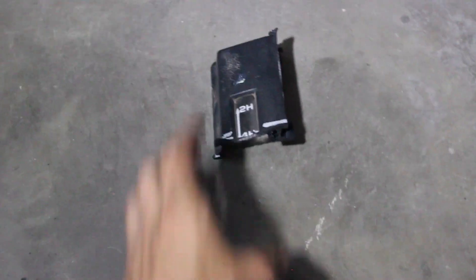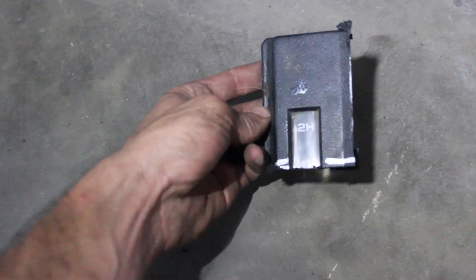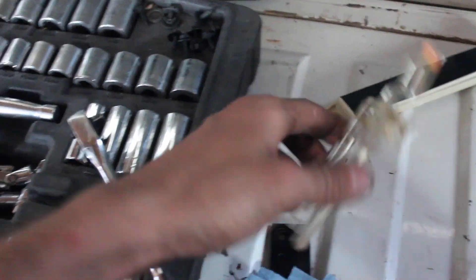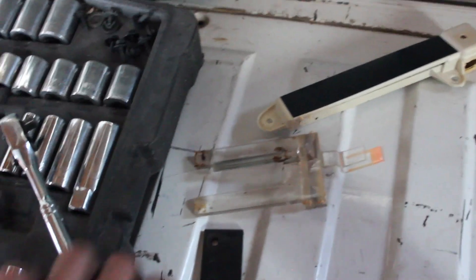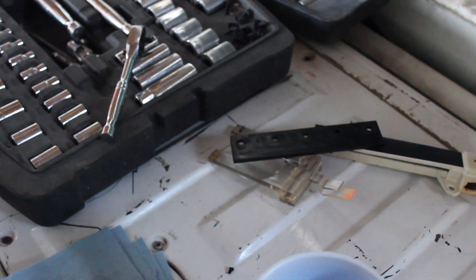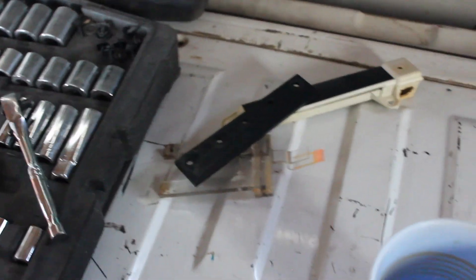So here's the sad part — this is about how much I cut off of my transfer case boot, got rid of that entire side. That side we lost two high and four high. Now you could adjust it so that it would fit. I had to take apart all of the slide mechanism within the little deal. That's the backing plate. Here's the indicator that shifts up and down that shows you what you're in — four high, four low, all that — but the light on my dash still does work. And I know the position of that transfer case, so I'll know if I'm in four wheel drive or not, not to mention there's manual locking hubs on it. But that's what I opted to go for — take your pick, do whatever you want to do.